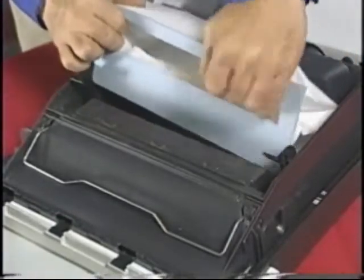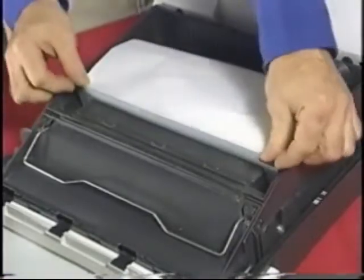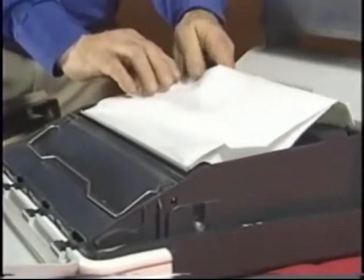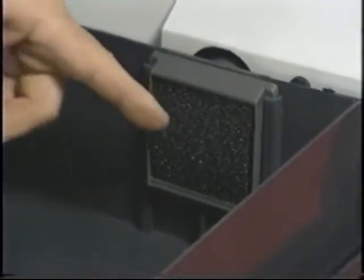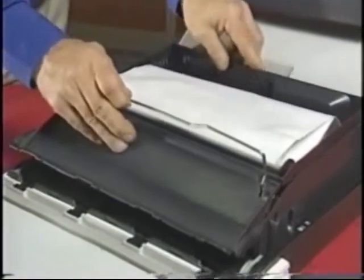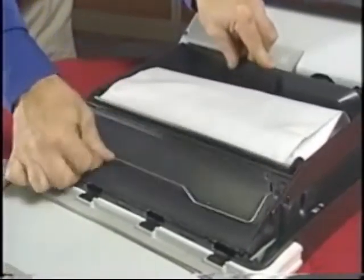But first open the mouth of the bag just as you would any other vacuum bag. Keep in mind that this is a much larger opening and it helps to open it completely. Once you have made sure the intake chamber is inside the bag opening, you can begin operation. Here's a tip: make sure the bag opening is in a straight line with no bowing at the top of the bag. You may occasionally have to assist the bottom part of the intake chamber into the bag. The key to any vacuum performing properly is getting the bag installed correctly. Visually check the filter before you replace the hopper.